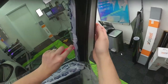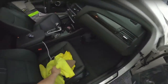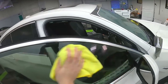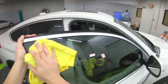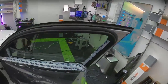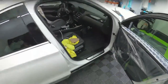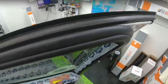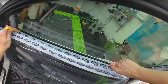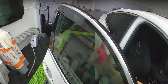Any advice on Tundra back glass? I would watch a video — there's some things going on with that one you really need to see rather than me trying to explain it. It's been a while since I've done it. I'd probably make little marks on the bottom corners that are a little bit wider, to kind of know where my ends are. It's a tricky window. If I remember right, the inside seal pops out super easily on the Tundra — roll the window down and that seal should just pull straight out. That'll make installation way easier.